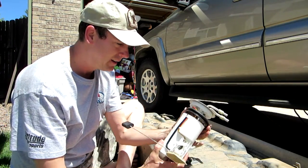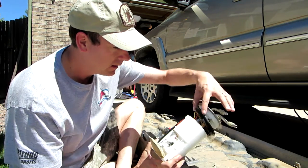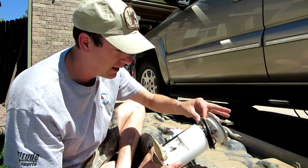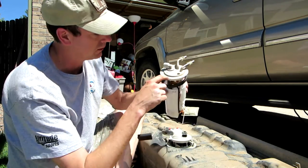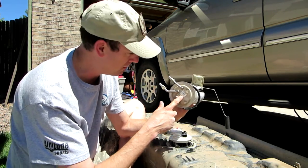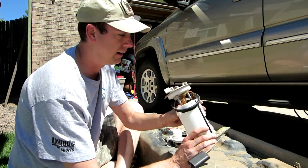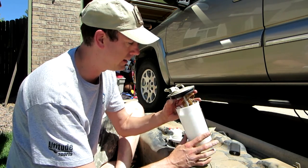You've got the old part here with a rubber gasket. It's only 2 years old. It's already cracking around the edges on the outside of the tank. So that's not great. This was an Airtex E3560M, which is a flex vehicle. This is a flex Suburban 2003.